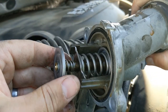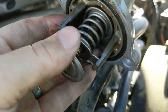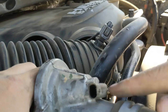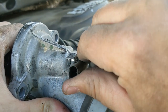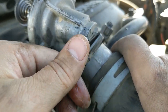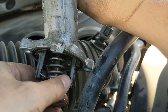Let's take a look at this. I can't really see any obvious point of failure. There's a little check ball in there that still moves around freely, and the spring moves in and out freely. I really expected this thing to be held open since I wasn't reaching temperature. The only other possibility is that maybe the sensor went bad. You'd think you'd be able to just replace the sensor — how much could that be, a twenty or forty dollar sensor? The expensive part is this cast housing machined out to accept a thermostat.